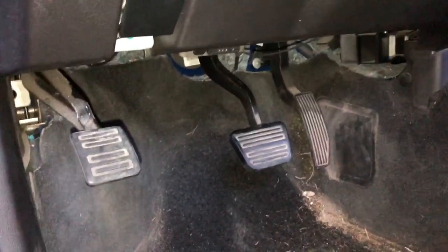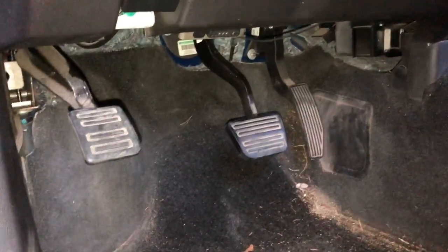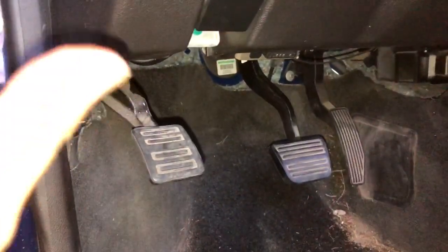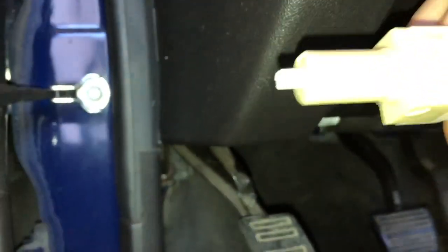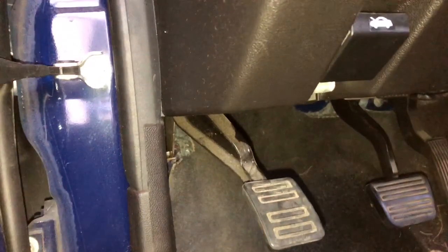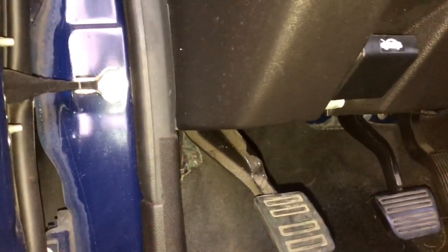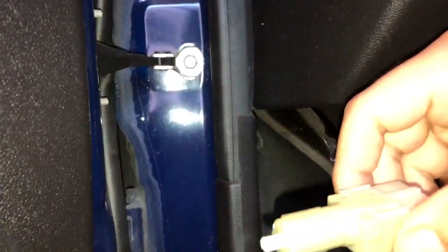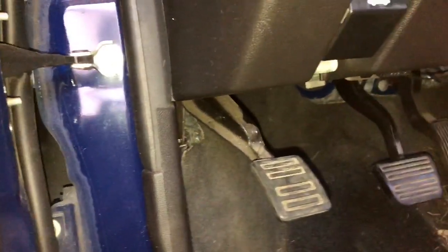What's going on YouTube, so today we're gonna be replacing a brake light switch on a 2012 Chevy Colorado. It's pretty simple, you really don't even need any tools — all you need is to go buy a switch. Sometimes your cruise control will start failing or your brake lights might get stuck. In my truck my brake lights stopped working, so I went to Chevy and bought it — it was about $19. Pretty simple, shouldn't take no more than five minutes.